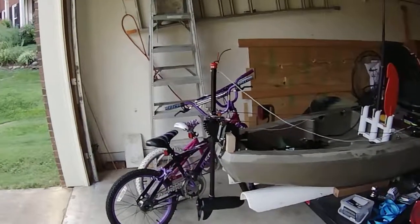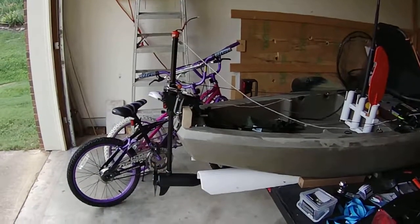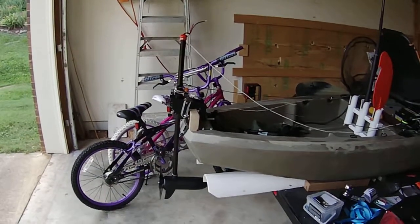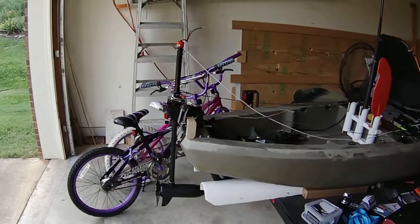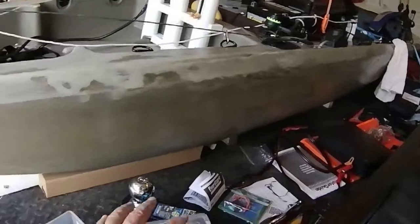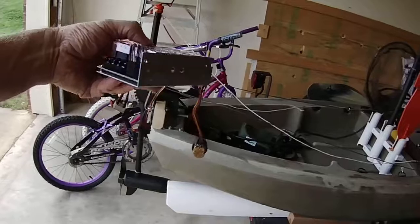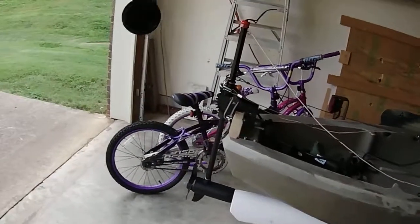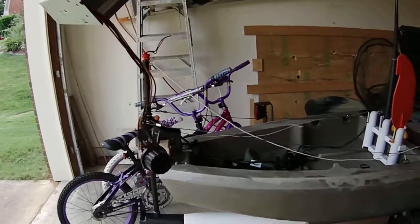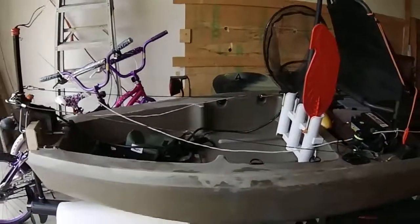You can see the head of this motor is not on there — it's just the two wires. The other two wires that go to the shunt are coiled. The way this one's done, I'm using a pulse width modulator. This item right here — I've got a little box I'm going to be installing it in. It has a speed control, forward and reverse and off, with a little meter that tells you what percentage of battery power you're using.